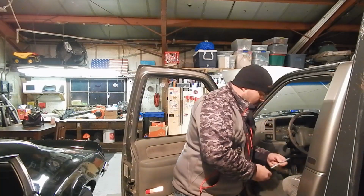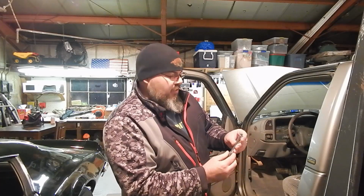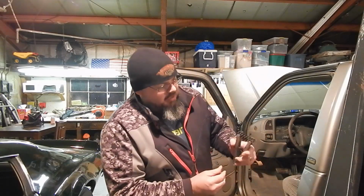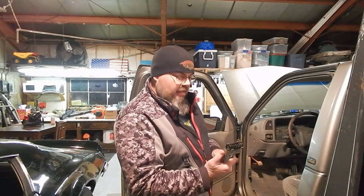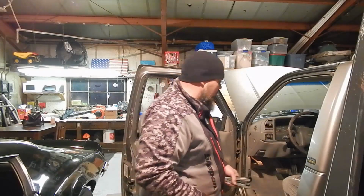And because the roller pin is broken, this is what's inside there. Your catch rolls on that. We'll have to grind the head of the old one off here, and then this will go in, and then we have to get a new spring. I've already got it stuck in the tool. This will be your spring compressor tool. To take them out, I usually just take a pry bar and pop it out. Be careful not to let it hit you.